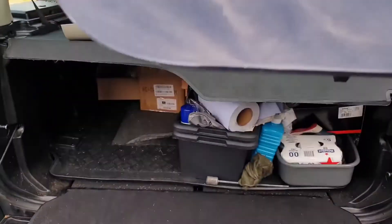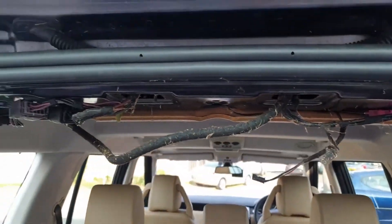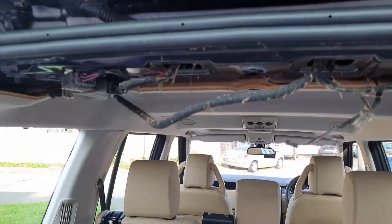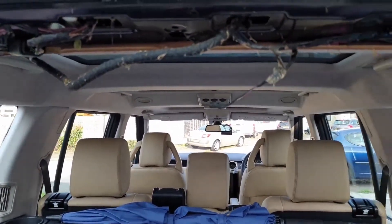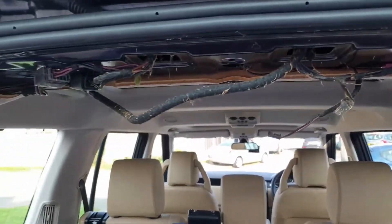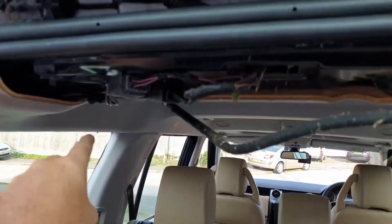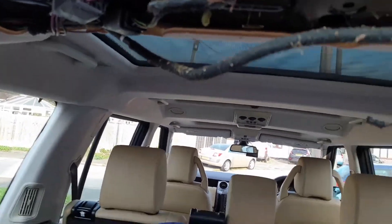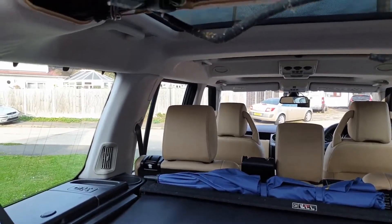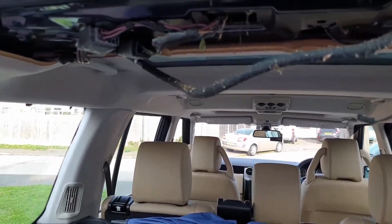I have been chasing a few water problems inside this car, as you can see by my previous videos — front sunroof drains, rear sunroof drains as well. And I suppose it's possible that the water could have been gathering up in here and actually running along the headlining and down into the wiring channel on the near side there, and filling that up. Who knows.